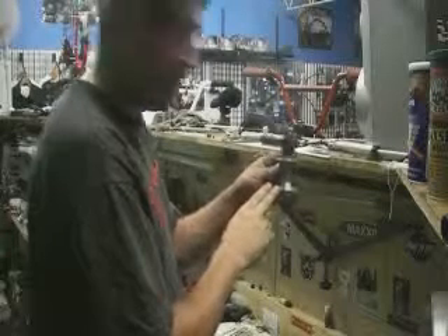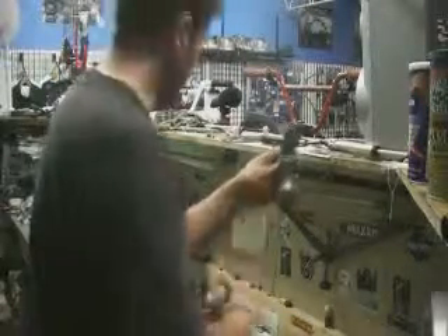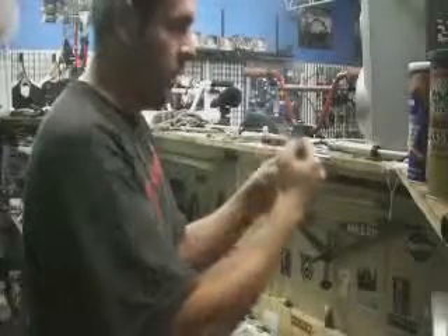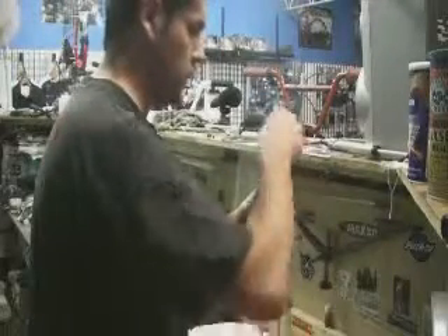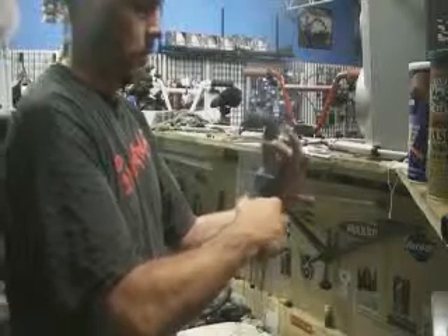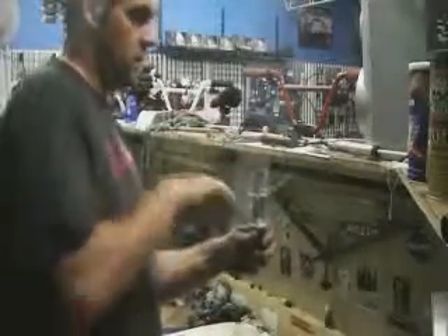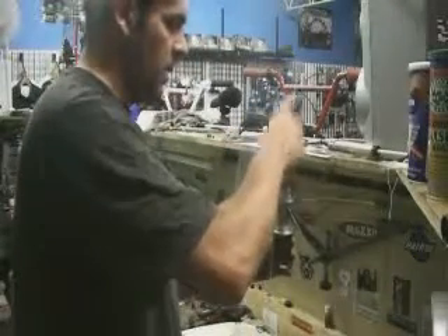Our next spoke on a B-type rim is going to go to the left — if it was an A-type rim, you'd put it on the right. You get your next spoke and put it in there. Now what you need to do is go around in every second hole and put a spoke in. We're going to double-check there's a spoke in every second hole. I'm going to carefully turn the hub over, then put a spoke down all the vacant holes. I'm using black and white spokes and that's going to demonstrate something later on when we come to lace the rim.